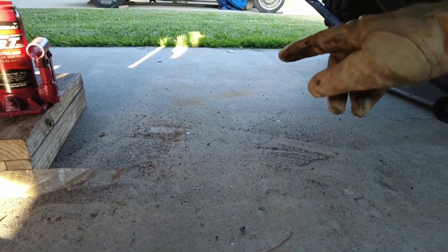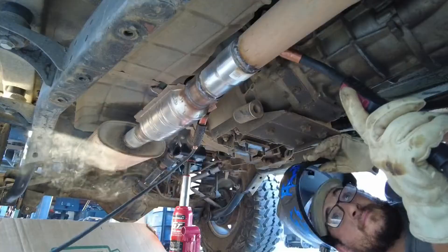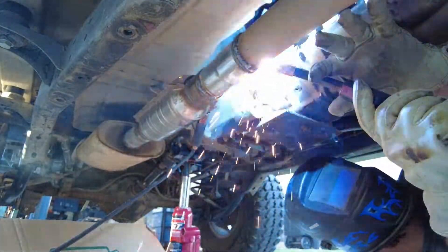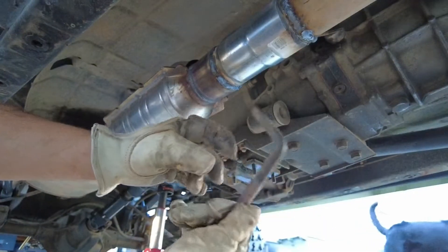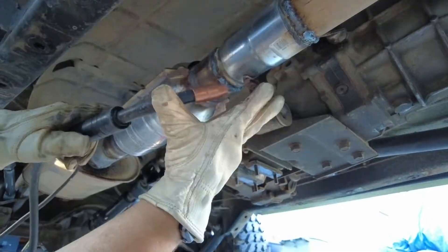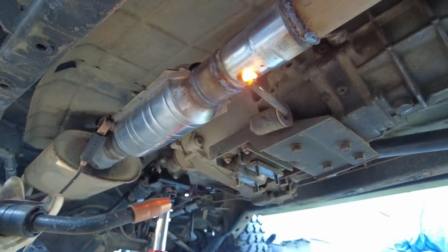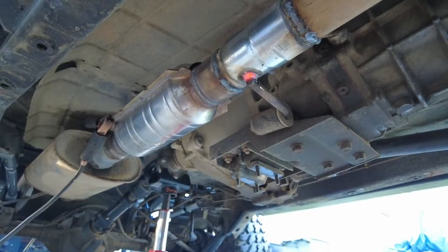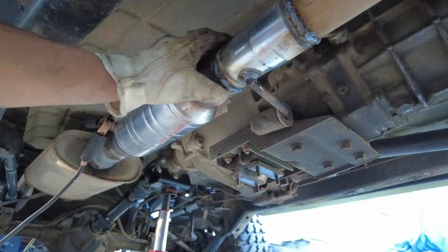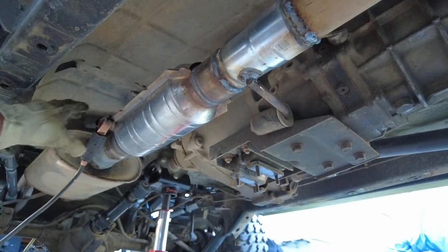I need to sweep this up so I can get on that side and finish the other half of the tubing, then we should be good to go. The last part to weld on is the exhaust hanger — it hangs on the transmission mount and you just weld it to the tube. That's going to work and I don't see that going anywhere, so I'm pretty happy with that. I'll check all the welds thoroughly one more time, fill any pinholes with the MIG welder, and we should be good.